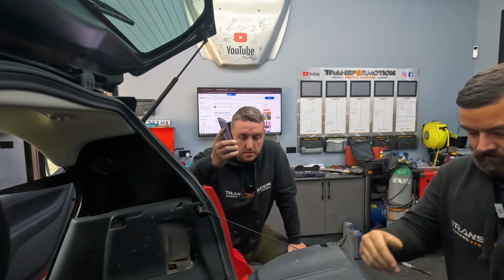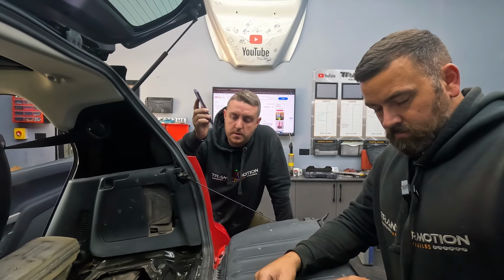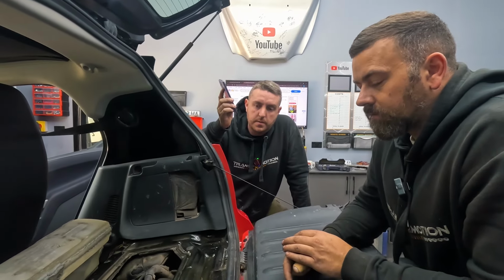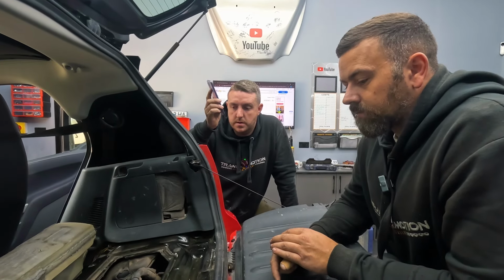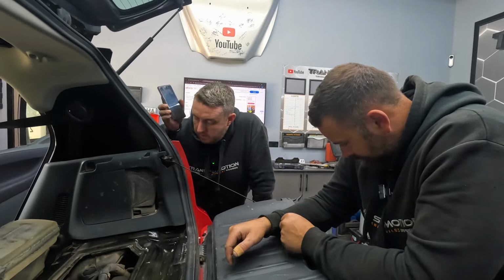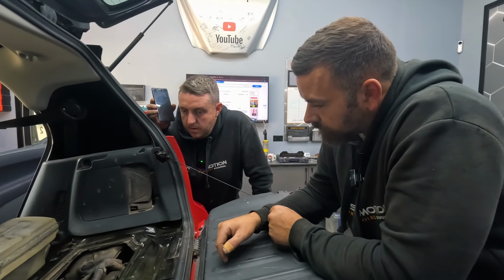The only way you can rule a big end out is if you take the plugs out and turn the engine over. Get your piston to the top on each one, then turn it so the piston starts to go down, and put a screwdriver on top of the piston and push it. If it drops, obviously you've got a bearing gone. But it's got to be on its way down, because the crank's pulling it down and the piston lags behind. The noise is right at the bottom. It could be more than one, it could be two gone. It's worth trying that first.